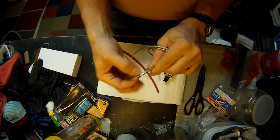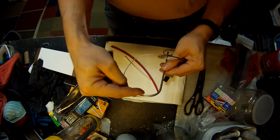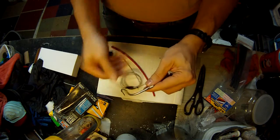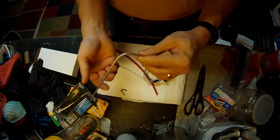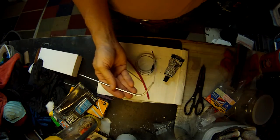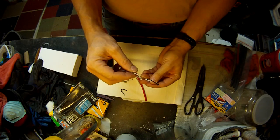and the pipe is crimped to keep the wire from pulling out because the thermistor is way down here in the bottom. But the problem is, if this tube fills up with all kinds of crap, like if you're a homebrewer like me and you get wort in there, that's sugar water and it's terrible. And these things last 3 or 4 immersions and then they die. If they get in any kind of boiling water, or if they get into your soup or anything, if you're cooking, it's too hot in your crock pot, water gets in there and it's bad. So I'm going to show you real quick how to fix that guy.